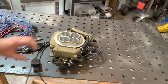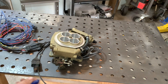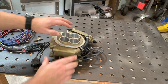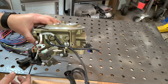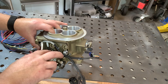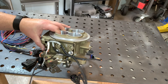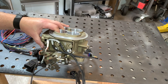So now we'll take the other side off. You can see in here it's just like the other side — some wiring for external devices, two injector holes. You can also see a little bit where the extra injector holes would be for a Super Sniper with eight injectors. The throttle bodies are exactly the same; they just don't machine the extra holes if they don't need them.